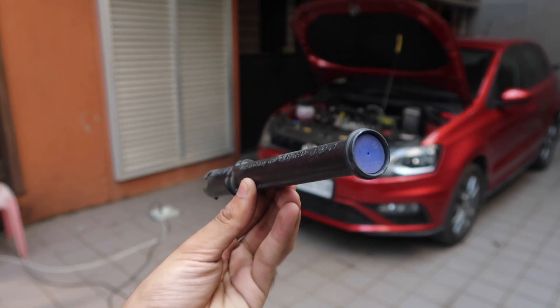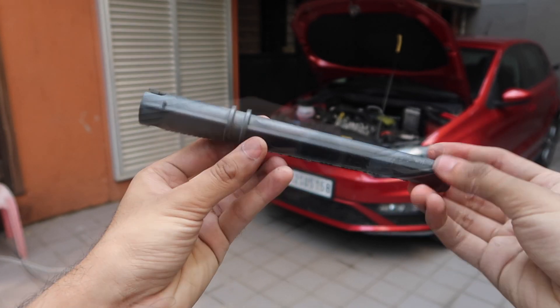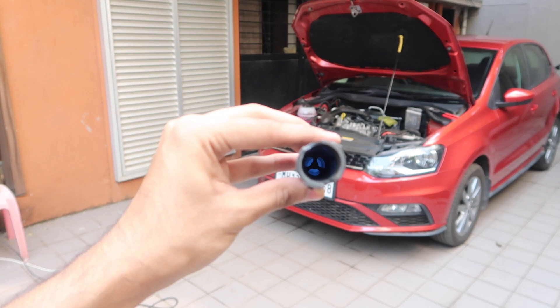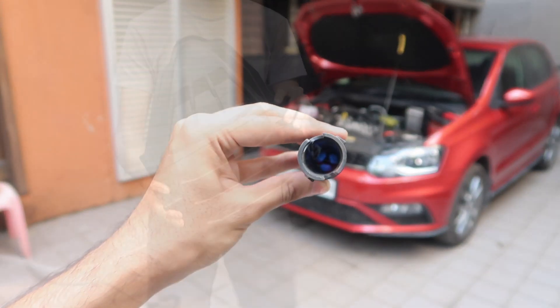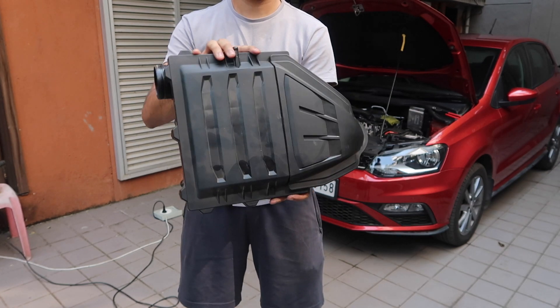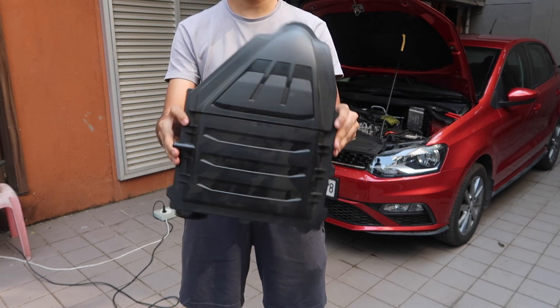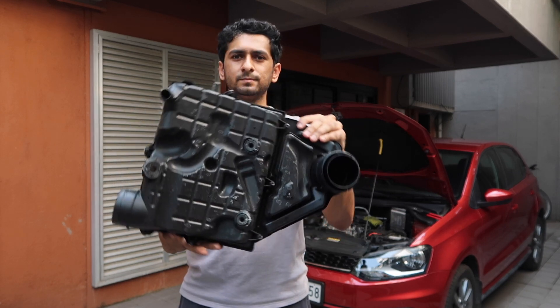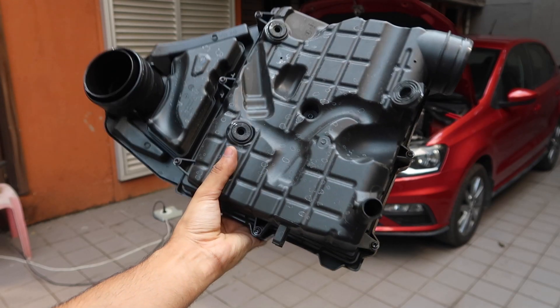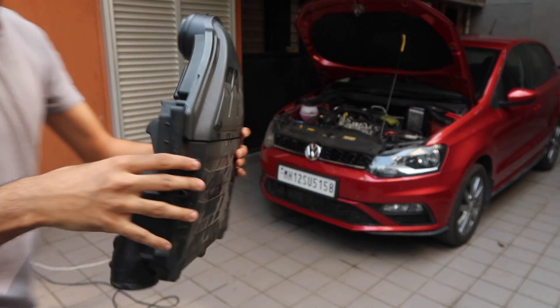This drain pipe needs to be inspected and cleaned with compressed air to allow a reliable passage for any water picked up by the intake to leave the air filter housing. If the drain pipe is clogged and not cleaned properly, there is a huge risk of water damage to the engine. The air filter box is made in Romania and, to my surprise, lacks any TSI branding on the Indian variants. I'm frankly not a fan of this design because it's incredibly stupid having to remove an entire intake assembly for merely cleaning an air filter.